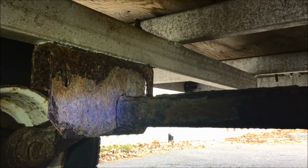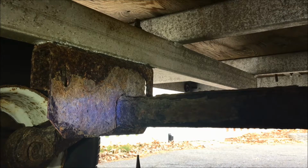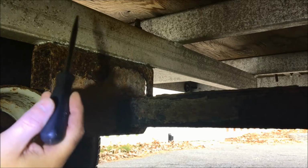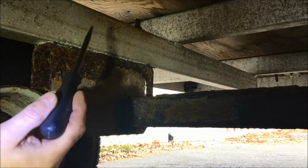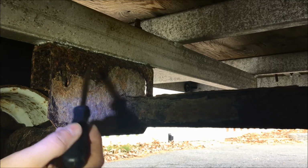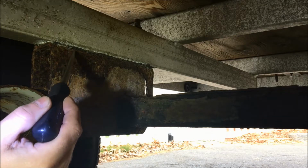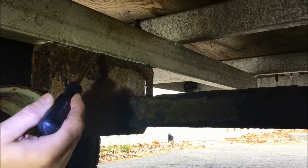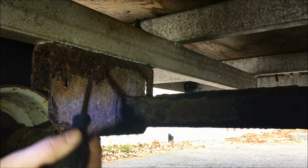If you were just to look at the trailer based on the surface, you'd say, hey, everything looks good. But like we were talking about before, when axles get ripped out, this is what happens, right? So what we've got here is 2 dissimilar metals. You have an aluminum frame, and then you have the steel axle, and up here you have the isolator, which prevents electrolysis. This is rubber, right?